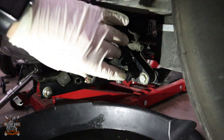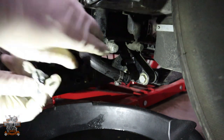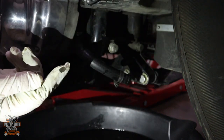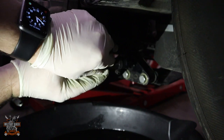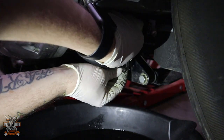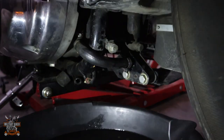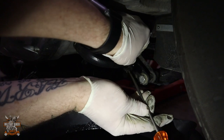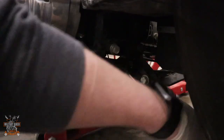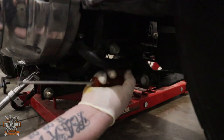She's more or less completely drained now. Give the end a little wipe off, fire the pipe back on the subframe all the way up, then snug your jubilee clip back exactly where it was before. Tighten it up — don't go too mad though because you will snap the jubilee clip. It just wants to be nice and snug so it's not coming off easily.